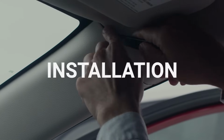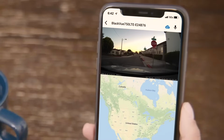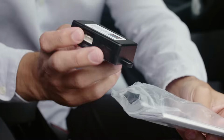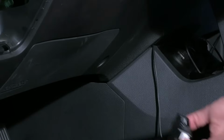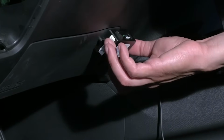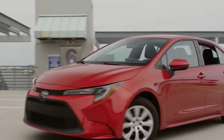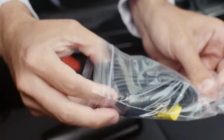It's time to start installing your dashcam. If you plan on using parking mode to monitor your parked vehicle when the engine is off, you'll need to use a hardwiring kit, such as the PowerMagic Pro or a battery such as the PowerMagic Ultra battery. In this case, consider the location of the power accessory when installing the dashcam's power cable. If you're unsure about using parking mode just yet, a simple installation with a 12-volt adapter will do for now.